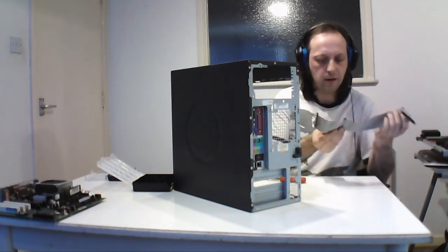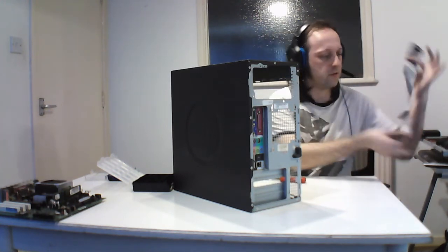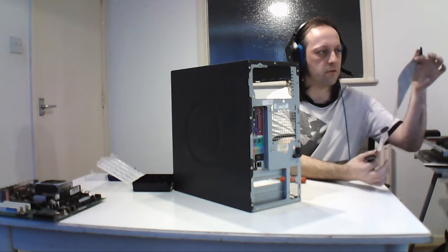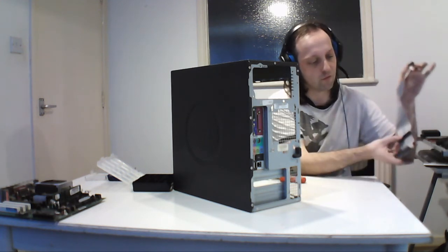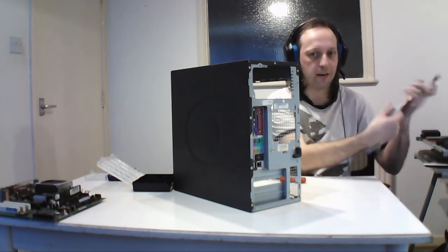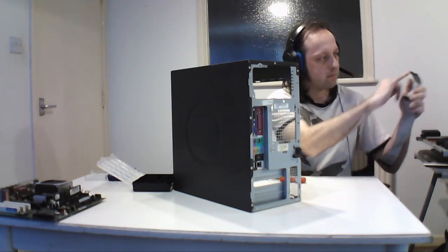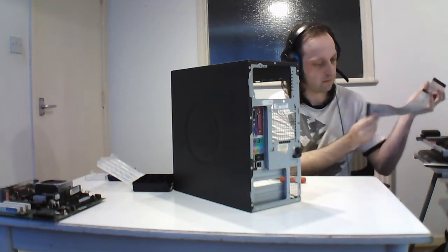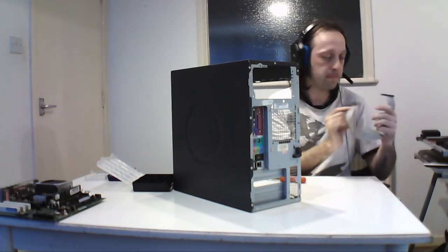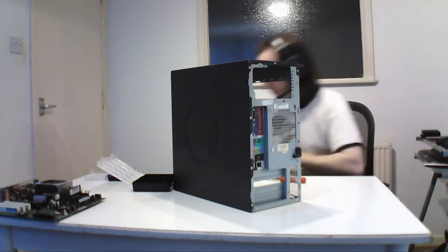And this is the cable. This must be a smaller type, so it's got 3 connectors, but you can see it says drive 0, drive 1, and system port. So if you had the cable select, that would be your master slave. See, it's black, grey, and blue normally, but yeah. So that's what that is.